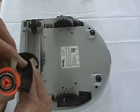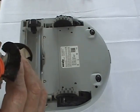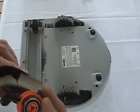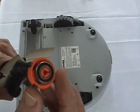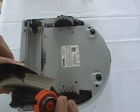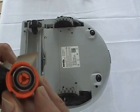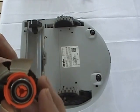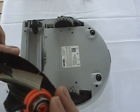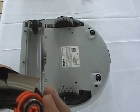You'll notice there's a sealed ball bearing placed on the end of this cleaning brush. This unit ships with a shielded ball bearing which fills up with dust and dirt, causing a failure fairly early, and your Neato will complain of a stuck brush. So get this sealed ball bearing replacement as soon as you can — you can check my website for that.